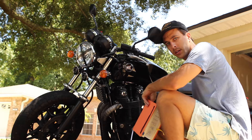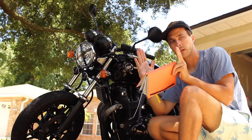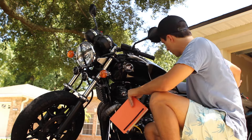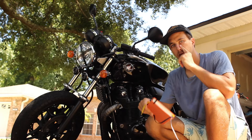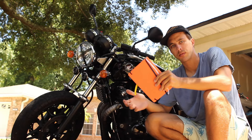For the blinkers, I took off the big side brackets and ended up mounting the blinkers straight onto the brackets that hang off under the seat, which brings the blinkers in a little bit so they don't stick out as far. I did have to trim a little piece of metal on the blinker — if you take it apart you'll see it has a little nook that keeps it from spinning, and I literally just trimmed that off and bolted it straight to the side bracket. Other than that, I did get the Quad Lock — I made a video about that, go check it out. That's pretty much it! Thank you guys so much for tuning in, let me know what you think of the updates. Make sure you subscribe and don't forget to check out Retro Racer Coffee — see you in the next video, peace.